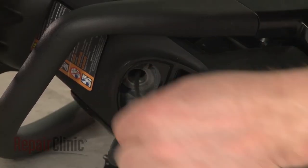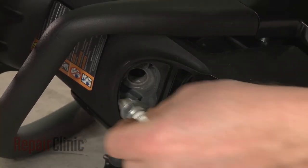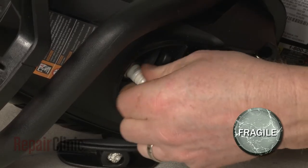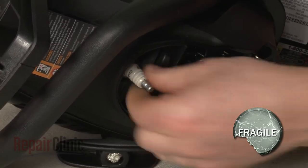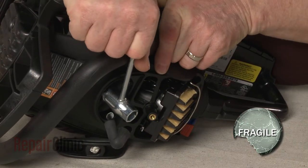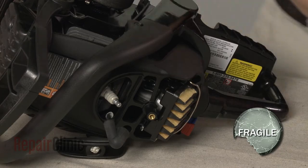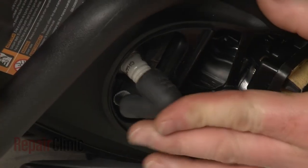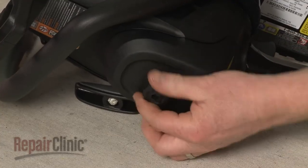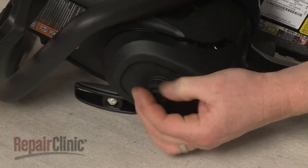Remove the cord from the cylinder. Re-thread the spark plug, being careful not to strip the threads by over-tightening. Re-attach the wire and boot. Re-align the air filter cover and re-thread the knob to secure.